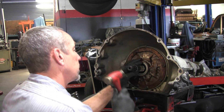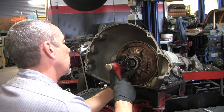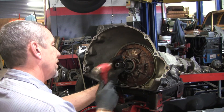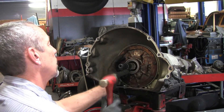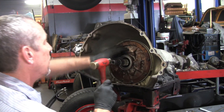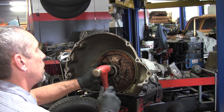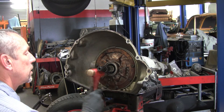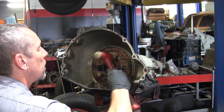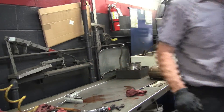This is the hardest part of the job — getting this seal to go on square without damaging it. Fortunately, this is not bought from Rolls-Royce, so it's not $70; it's like three to five dollars. They make a tool, a big driver, that you can put this on with — I have yet to make that one, and it's only been 30 years. There we go, I got it to bite. This is a brass hammer, by the way — I don't recommend steel hammers for a lot of these things.